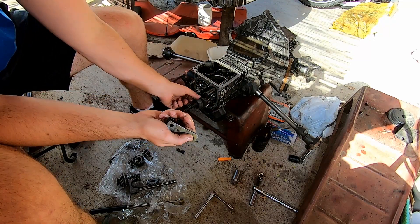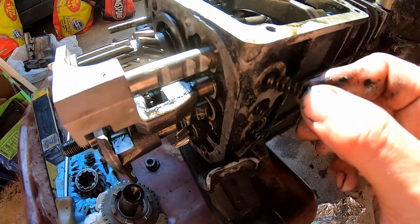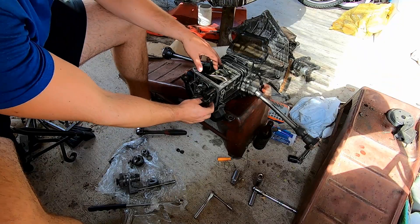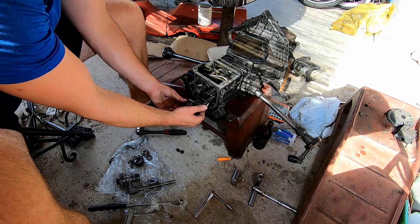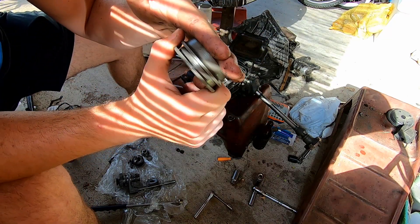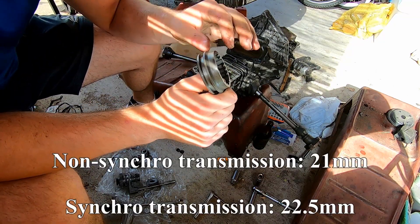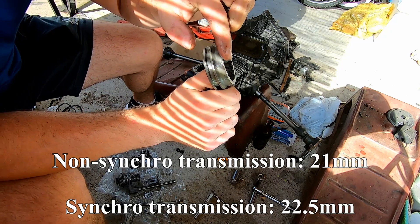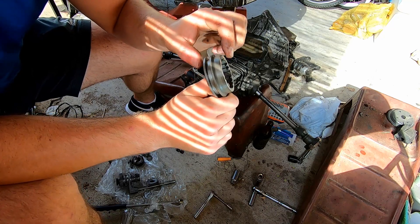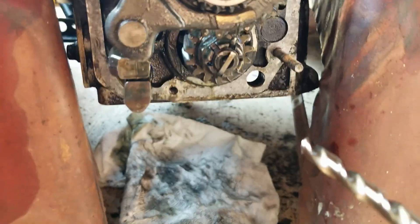You can pull this out. When you take material off of this, take it from this side. If you have the 500, it needs to go down to 21 millimeters from here to here - 21. If you have the 126 style with the synchros, it's going to be 22.5 millimeters from here to here. I've got this upside down here.